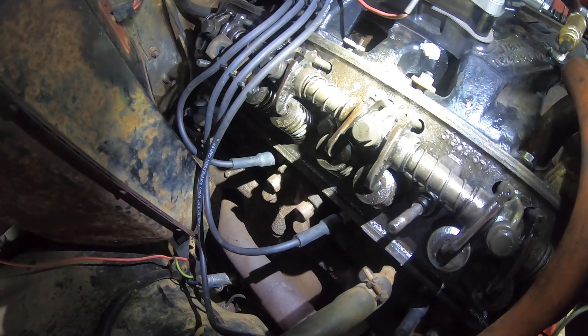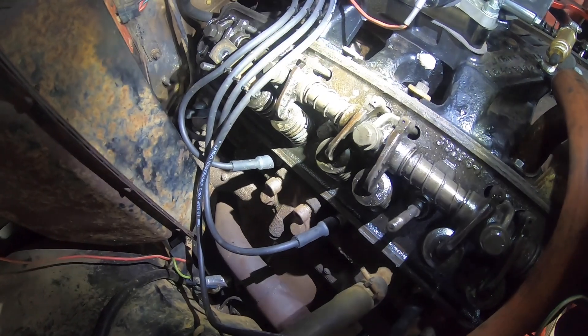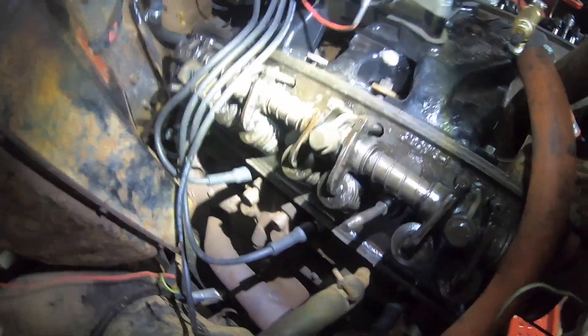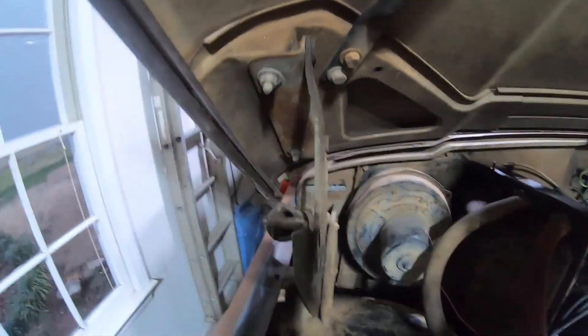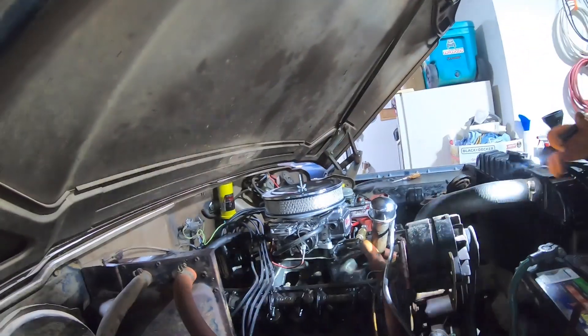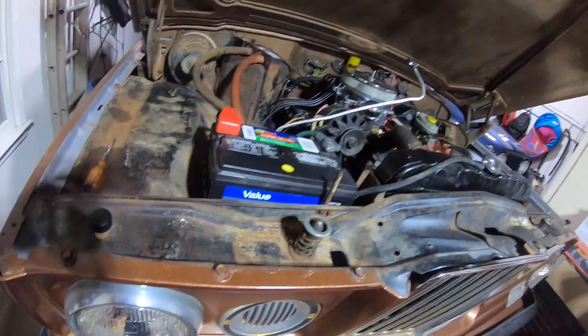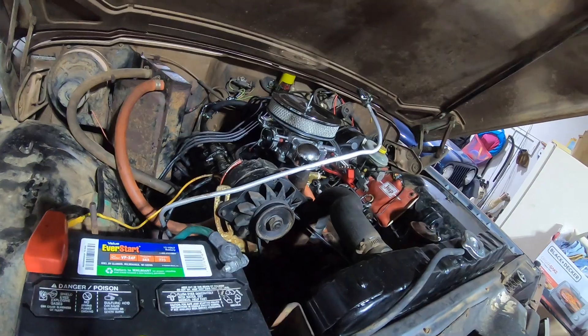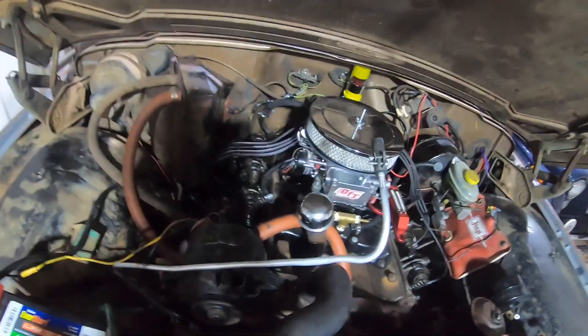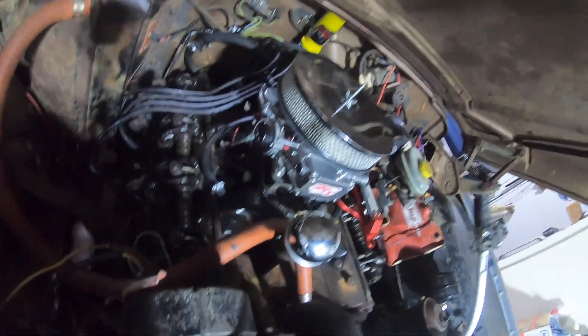It's kind of seeming to me like it might not be a collapsed lifter. I'm going to take a look at this rocker shaft and see maybe we didn't torque it down tight enough — that could be what's causing all this. I tried to adjust the lighting but now I'm blinded after staring at that thing. It doesn't look any better, probably because I'm standing in the way. Let's just put this thing on the tripod.